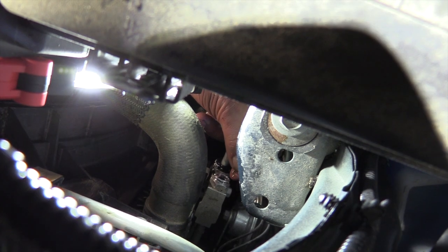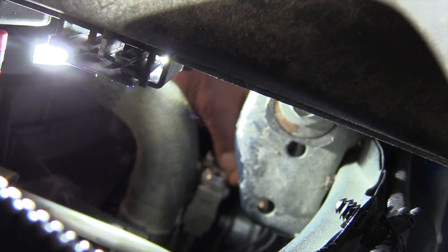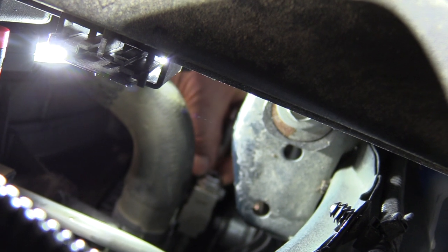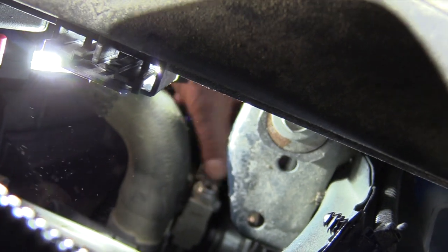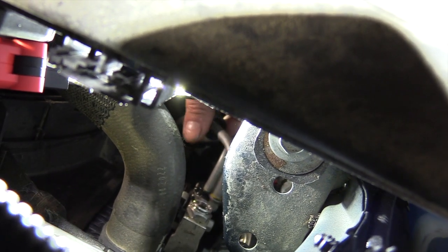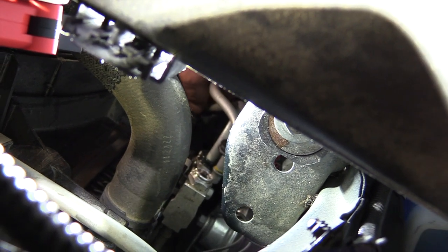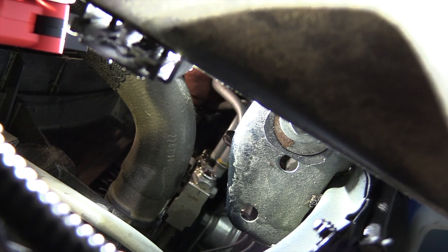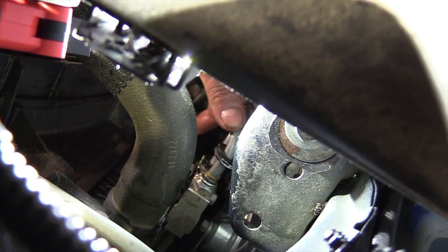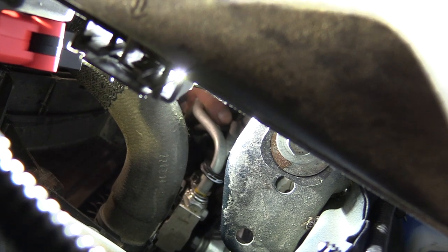Okay, I've got this little clip right here, and we're going to put it back in. And you can see there's slots around the outside of this. And right there at the bottom, I'm going to bridge that slot, and I'm going to push this on. Just like that. Okay? Now that's on. Now I can bring this other line up. And that line has got that little keeper. Make sure that keeper's up there fairly close. And then I'm going to try to finagle it so I can get it into that clamp down below, that plastic clamp, and this at about the same time. There we go. And what we do, take a look here quick, make sure I got it where I want it. Yes, I do.